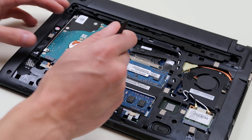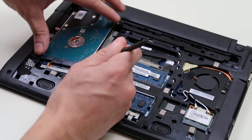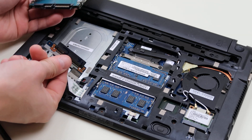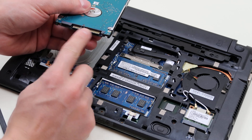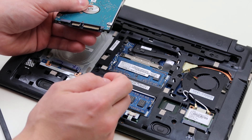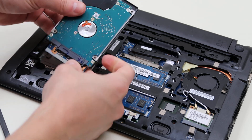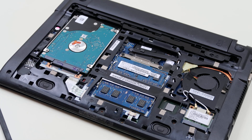The hard drive is placed in there and we're just gonna pry this up a little bit. It's plugged into the board right here, so slide it out of the board like that. Same thing — this has an orientation, a long port and a short port, so when you're putting the new one in make sure you get it the right way. Snap that in and then it goes down like that.